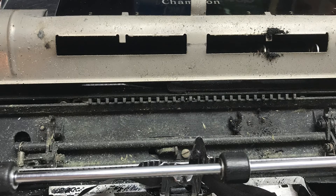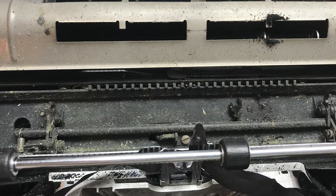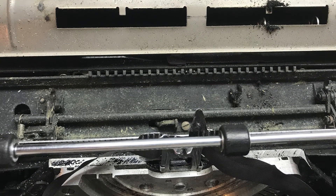I got it home and it typed, but it didn't type super well. As I was using it I was noticing some gunky things showing up in different parts of the typewriter - whether that was under the platen or when I rolled paper through - something just seemed off. It took me a while but I finally got to taking it apart and noticed that almost all of the rubber parts on this machine had over time corroded and become gunky and gummy like slime. Any rubber padding or rubber O-rings that were there to make clamping easier or quieter had just kind of disintegrated into sludge. That can happen when oil or mineral spirits gets into rubber parts and breaks them down into a putty. I cleaned those out, which helped, but as I set the typewriter back down it still wasn't typing super well.